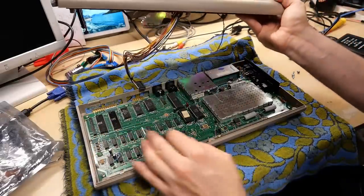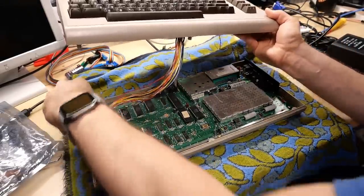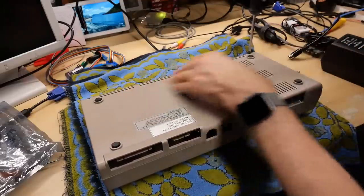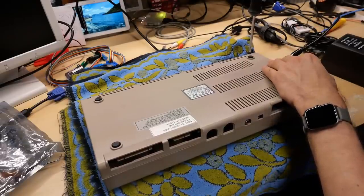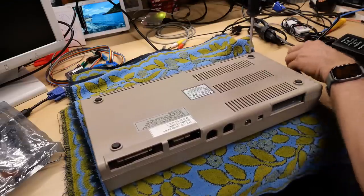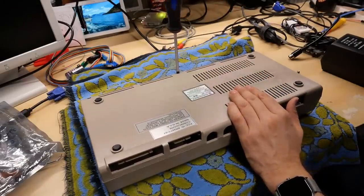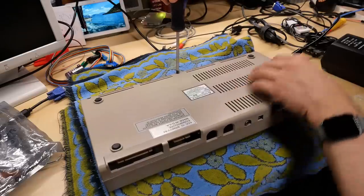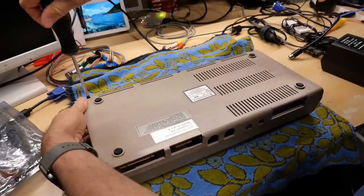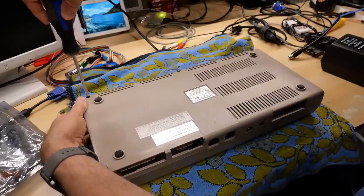At this point I'm not going to do anything to this machine — I'll just put it back together and put a note that the SID may have a potentially bad analog input. Remember when putting screws back into plastic standoffs like these, you should go backwards until you hear a click. There's the click — and then just lightly tighten them in. You don't want to create new threads; these are self-tappers. If you go backwards until it clicks, you know the screw has fallen into the original threads created at the factory. Thank you to Fran Blanche for turning me on to this technique.